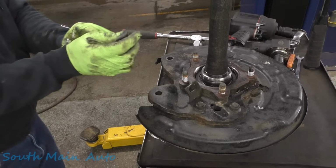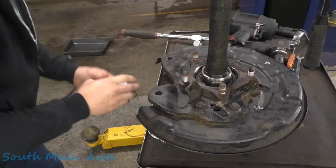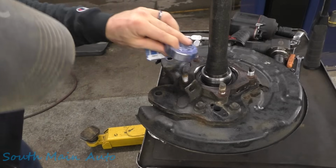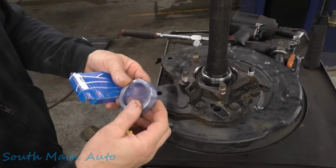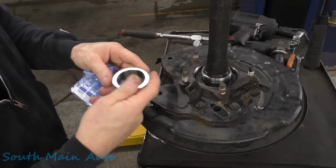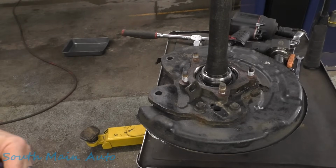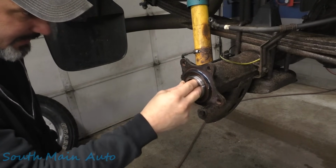Well, I'll tell you what, let's deglove ourselves. Not in a literal sense, because an actual finger degloving is not fun. Okay, it is pretty wide. Okay, I thought it was a little thinner, because this is where the sealing surface of the inner seal rides on this. And this is also our bearing retainer. Okay, once we push that on, it presses on, holds the bearing on, but we need to remove the snap ring first, which is already loose, which is great. Let's make sure the outside diameter of this is good. That fits in our seal just lovely.